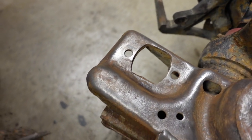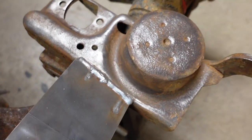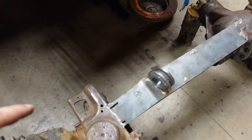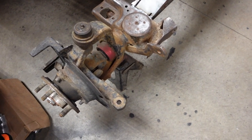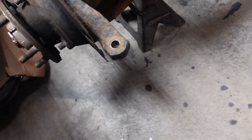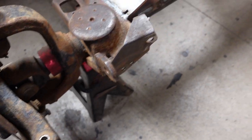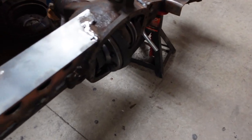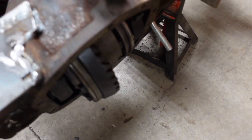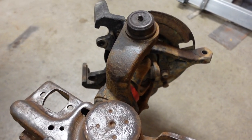I did what I can until we get the axle fitted up. Basically all the wire brush does is polish the rust and get rid of anything loose to get ready for prep, but there's still lots of work to do. I need to take out the axles, take off the spindle, and really clean it up. The differential has to come out for cleaning and inspection.